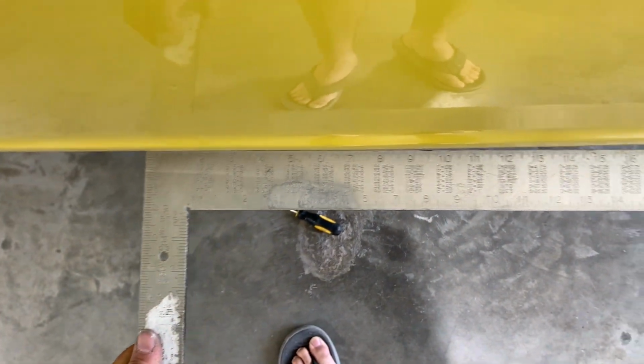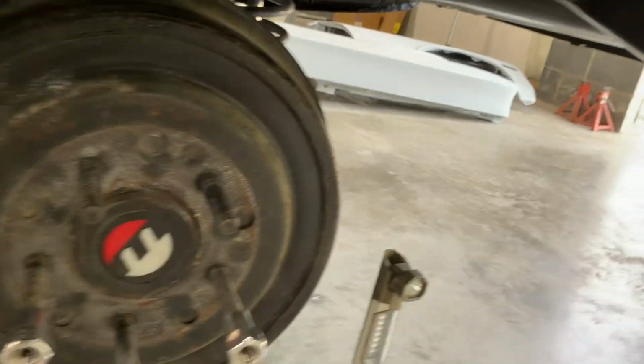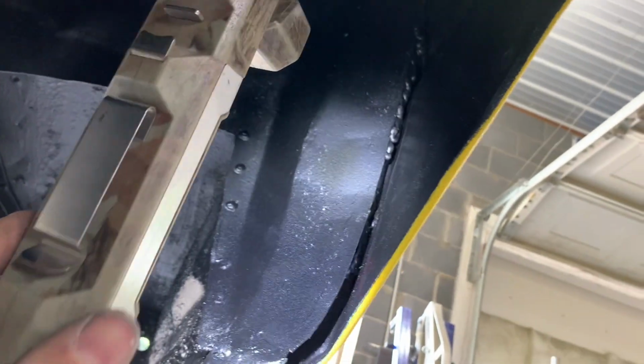and you put it in the same place, you can see that it's got a bulge. Got a bulge in it right about here. And this car's been mini tubbed, 4-length. And if you look up in here, what I'm thinking, the bulge is right here, right in here, down through here. It looks like they haven't pulled the quarter panel, this bottom edge, in far enough.